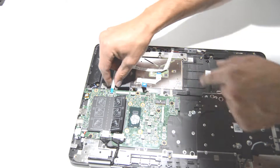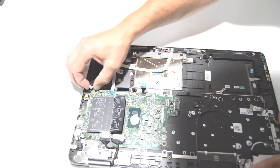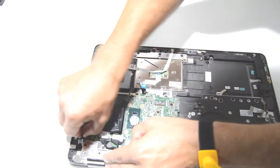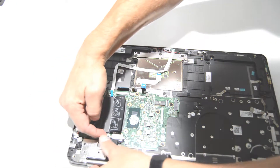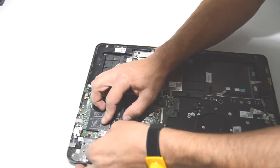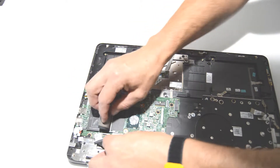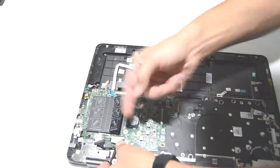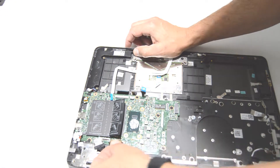There's one on the front as well. Pull out the connector for the speakers, and one for the DC jack — flip that one up to release the ribbon, which is a little bit stuck on with adhesive on the bottom, so wiggle it a little bit. For the video cable, peel up and free that little bar, then pull it out sideways.